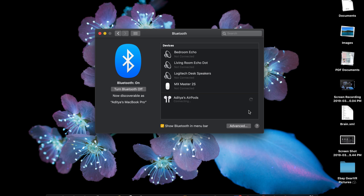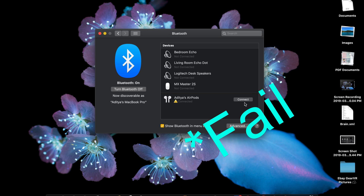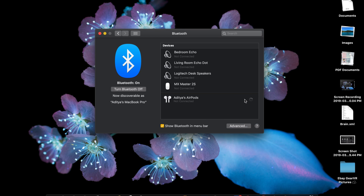It's a little bit annoying to do this, but after you do it should be fine for the most part. The best way to fix this problem is to unpair completely from your iOS device, have it forgotten on iCloud, and completely start over as a brand new AirPod.